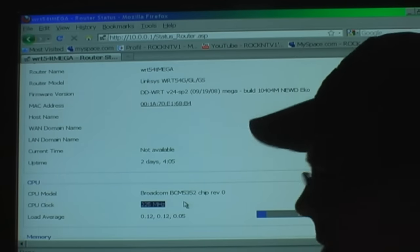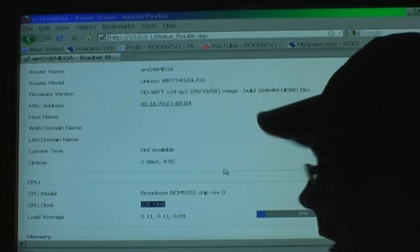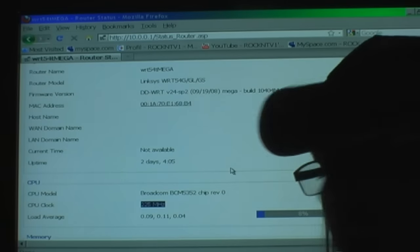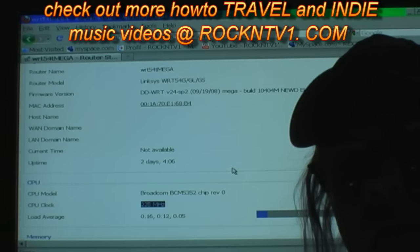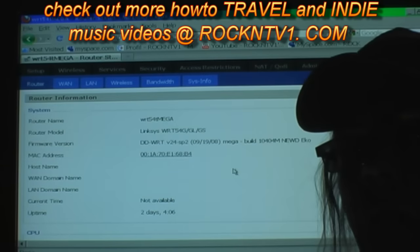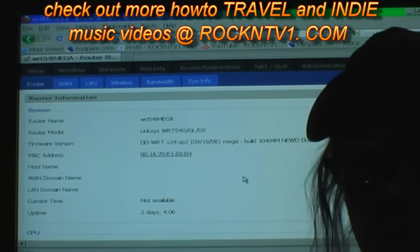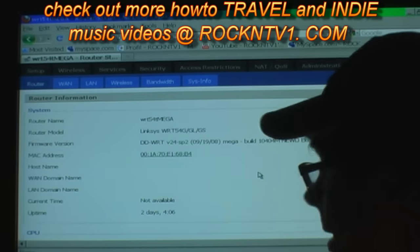It will go up to 250 megahertz. Honestly, I can't understand a reason why anybody would want to overclock this unless you're using it purely as a Linux computer connected to its network capabilities — four 10/100 802.11G-speed ports. For that reason, maybe you would want to overclock it if you saw it necessary. I have not found a reason to put a heat sink on this router. It never gets warm enough to the touch to necessitate any of that, unless it was piled up in books, on the floor, on carpet, or some other situation that really shouldn't be.